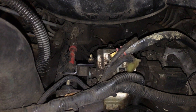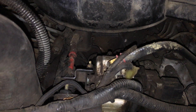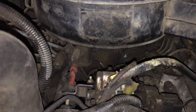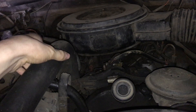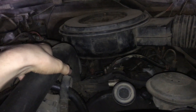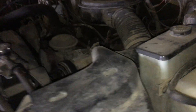You've seen my previous videos — it runs rough and smokes really bad. It looks like maybe an injector is putting too much fuel in, making it run rough. It's hard to start, and when it's warm it still runs rough and misses. Also, all eight glow plugs are confirmed not working, which I'm sure is part of the issue.